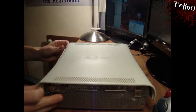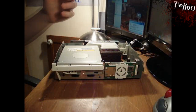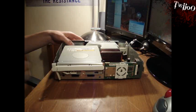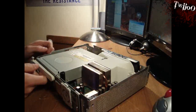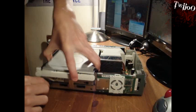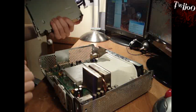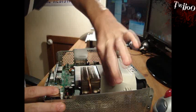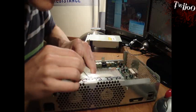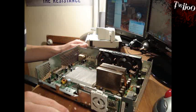Once you've undone everything on this side, flip your Xbox over and the top of it should lift off. Now then. Next thing you want to do is remove your DVD drive and put that to one side. You want to lift out this white cover here — that will come out. There you go. You're left with your fans in, so you want to take them out next.